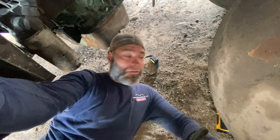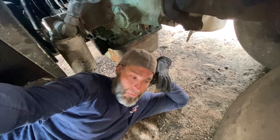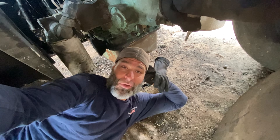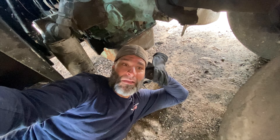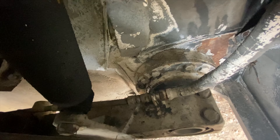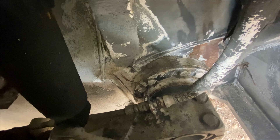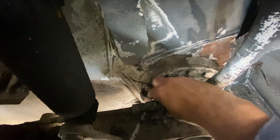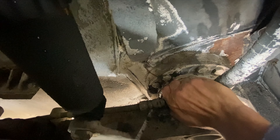Now I'm under the rear end of the bus. I got kind of lucky on the bogey wheel — I actually thought the brake chamber was out, but it turns out it was just the brake line, so it might just be a better idea to go have a new brake line made. You can see the air pressure just blows the mist away when I check it, and I put my hand on it — there's for sure a leak right there at that swivel joint.